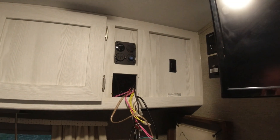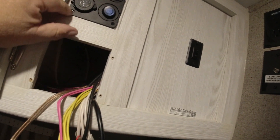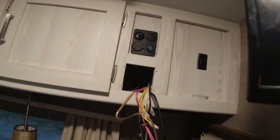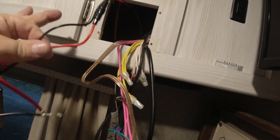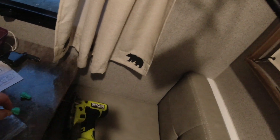I got that dry fit in there, and now I'm going to put in the four screws, one in each corner. I had to go over it several times because I wanted to make sure that hole doesn't extend out past the box — there's not much area to work with. We run the wire down through here — here's the two wires, black and red. It does have a small fuse in this one, so you want to cut it down below that to utilize the fuse. We're going to disconnect those clamps that Forest River uses and use a big wire nut instead.